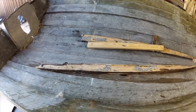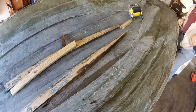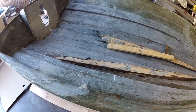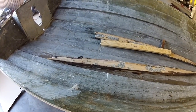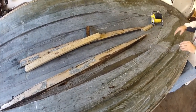That's why when I'm looking at boats, the first thing I do is walk every inch of the deck, after what I got burned on that Sea Ray. I just want to make sure it's 100% okay. Hopefully this helps as far as rotting is concerned. I would definitely advise everyone to do more investigation before they try to patch a deck. It's not very often you can just put a little patch in there and go out on the lake.